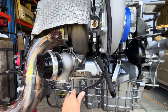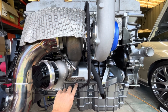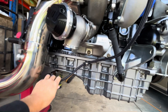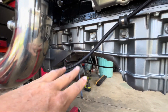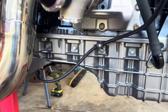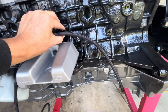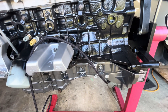I might be able to attach the oil line to the water line with some cable ties, or even get away with another P-clamp with the hose kinked at the right angle. I've put a P-clamp on the sump bolt loosely and I think that might even work — it's all just got slack but it's following the flow we want. I'll tweak all this when it's in the car. The last thing to do is get the fitting in the filter on the other side. Spinning the block around — it looks like the hose kinks up on an angle, I've chucked a 45-degree fitting in the back of the oil filter and it lines up pretty much perfectly.